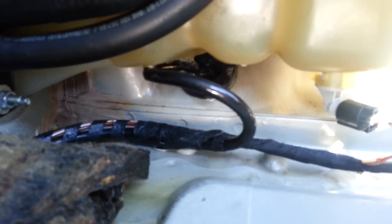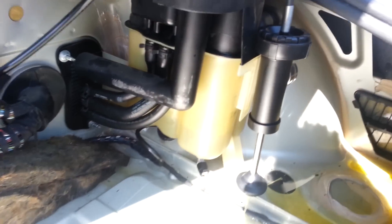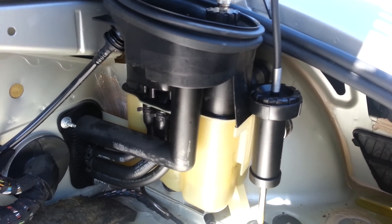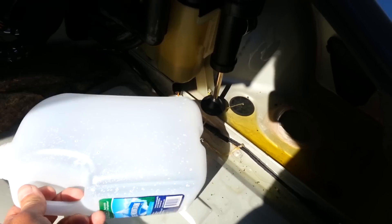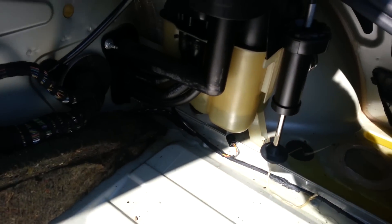Sad, but at least it's a definitive test that there's something wrong with my overflow coolant tank, which means this entire unit needs to be replaced. Now here's the other tip: you're going to be tempted to go on eBay and find a used piece. But the minute it starts showing that yellow color instead of a very clear milky white - like my distilled water container - if it doesn't look like that, you're an idiot to buy it no matter what the price.